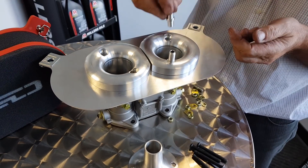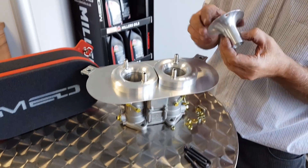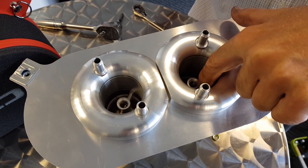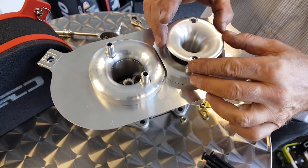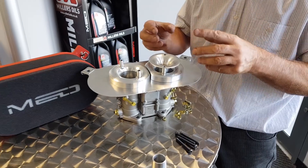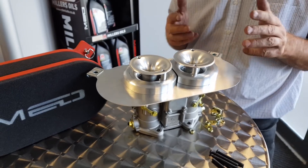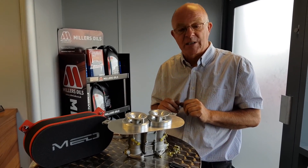Little aluminum posts going on like so, and then you've got the rams that go on the top. What these actually do is force the air down over the venturi, which then helps pick the mixture up and disperse it quicker. You still get enough air through here to feed the carburetor, but it just enhances how it mixes — that's why these work so well. You would have to change all the jetting then to make these work. It really does need re-jetting; it won't be far out, but these do need re-jetting just to finalize them.